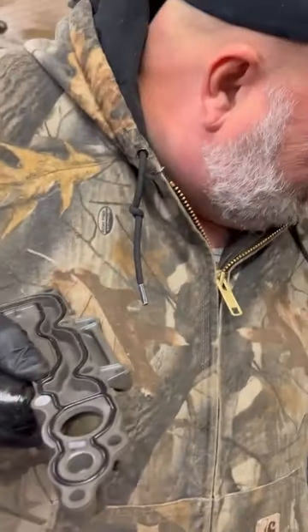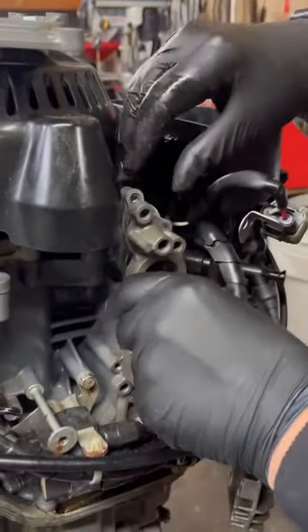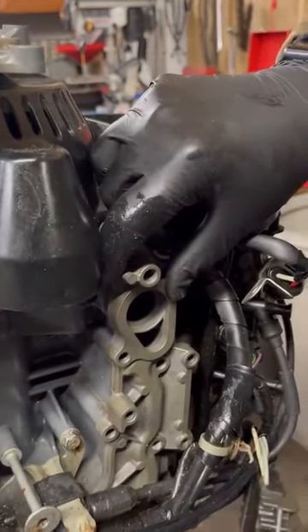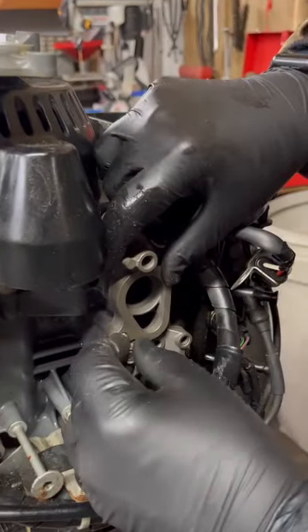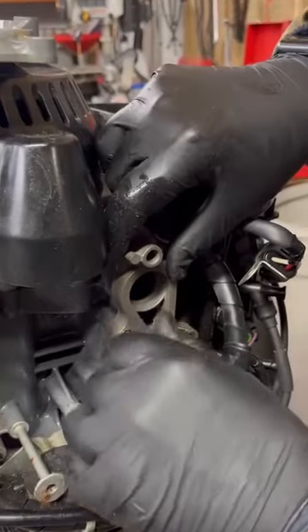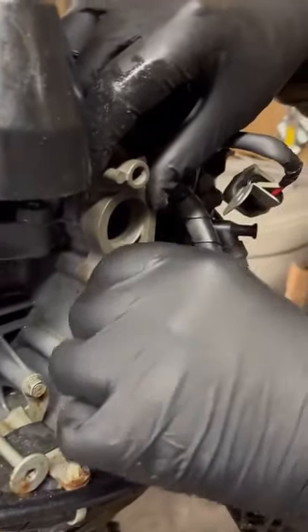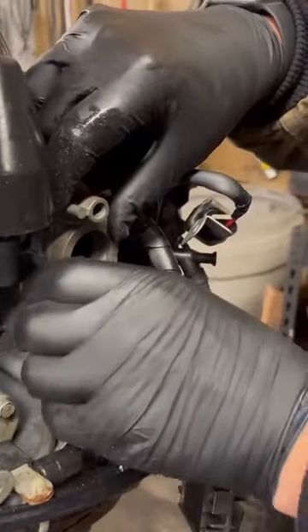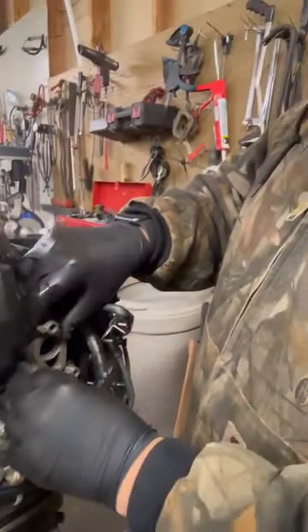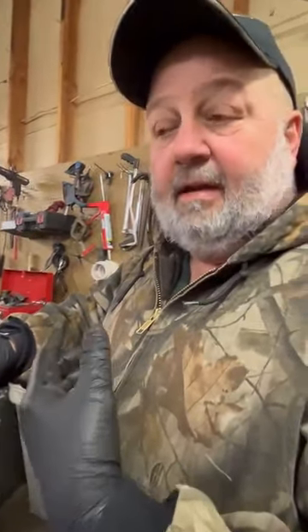With that done, I'll show you what we did. Now you can take your cover — your water jacket cover — and it will fit flushly. This is the new one, and we can go back to the standard regular bolt once you put the thermostat cover on. As you can see, it will screw in — you haven't lost any integrity of the structure of it, but you've also been able to use the correct bolts again, and you haven't lost any of your gasket either. That's how we do it.